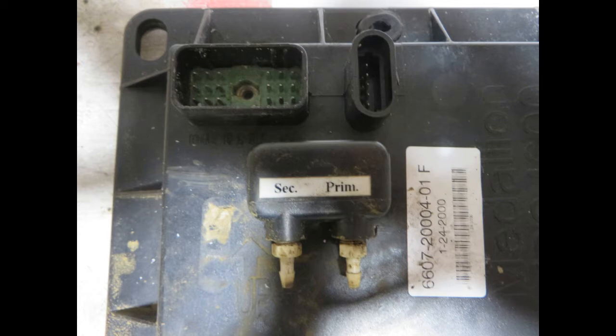In this case, the circuit board has been completely violated. Water has obviously gotten into the board and I'm sure this MDC is going to test bad. This is the most common failure for an MDC — water intrusion into the circuit board causing corrosion. Another failure we've seen is somebody will connect their battery backwards, getting the polarity wrong — connecting the red to the negative and the black cable to the positive post. This has also been known to destroy these MDCs.